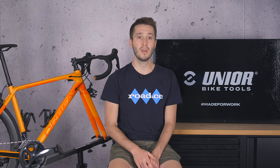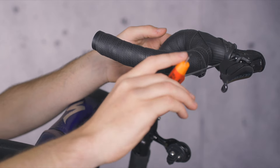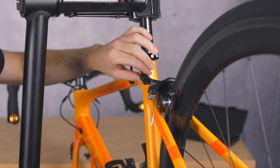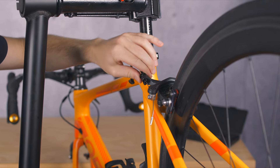What you do depends on the shifters you're working on. With the Ultegra R8750 Di2 disc shifters, there's a little screw under here. Turning it clockwise will increase the free stroke and counterclockwise will decrease it. I like my brakes to engage with a very small pull on the lever, so I'll do a bit of turning counterclockwise. For rim brakes we can set the pads closer to the rim by either unwinding the barrel adjuster or resetting the anchor bolt with pads closer to the rim.